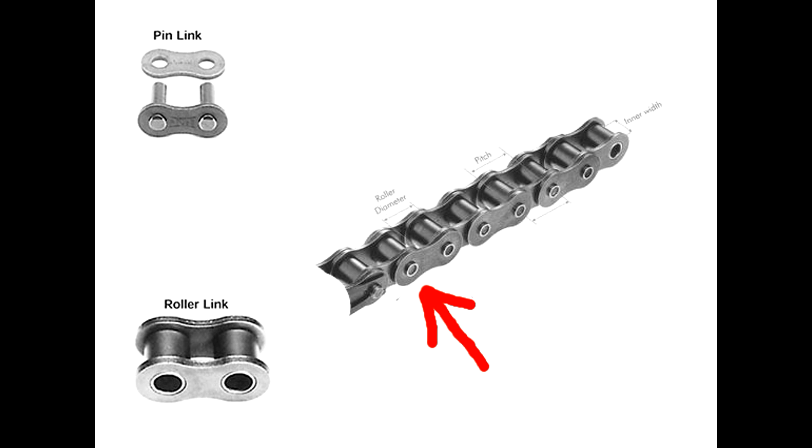You also have the other connector plate which is then pressed on. In order to break the chain, we're going to use the tool. The pin on the tool is going to press down on the chain where you see the red arrow, and that is going to drive the pin through the connector plate. You have to do that twice, and when you've done that the pin link will come loose and you have successfully broken your chain.